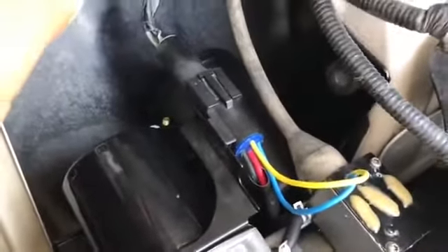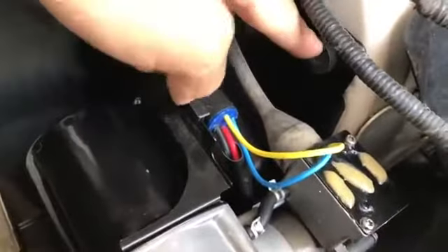I discovered a few things along the way. There are three bolts you have to take care of: there's one here, one down there on the side, and then one just in behind the compressor — it's easier to do that one from underneath.